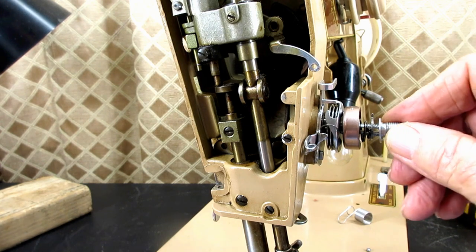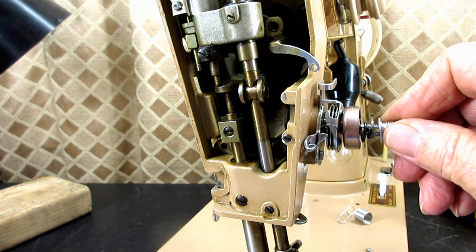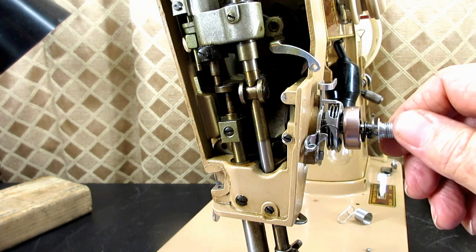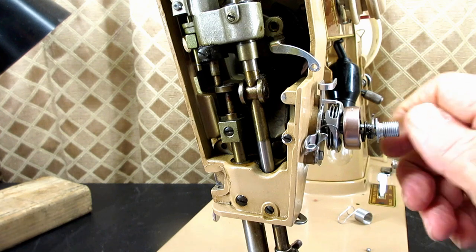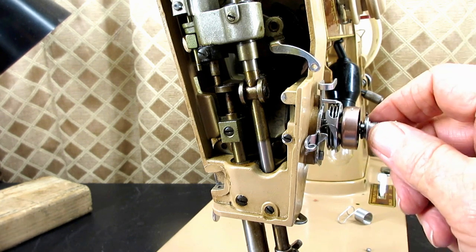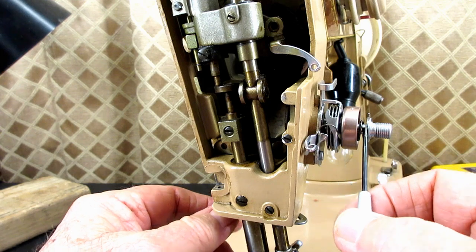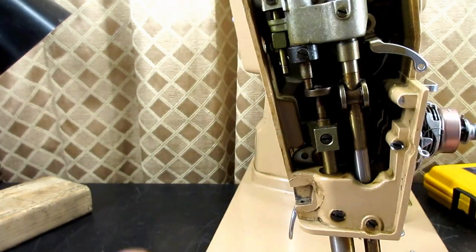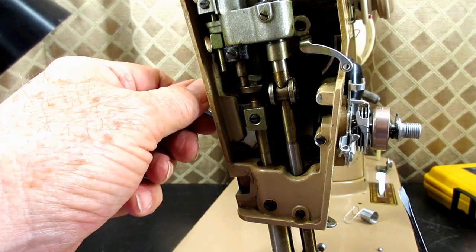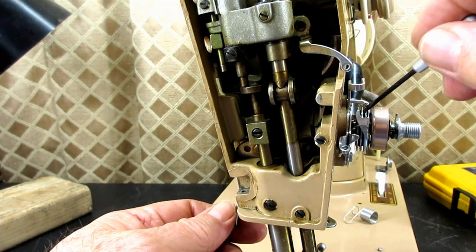Nobody makes these studs anymore that I know of, so be careful threading this — the stud is aluminum and you don't want it cross-threaded. If it doesn't want to go on and is kind of crooked, just kind of twist it backwards — left — or wiggle it until you get it seated flat. It should be fairly easy to put on; you'll feel some resistance. If you get it up or down you could strip the threads. I turn it backwards while pushing — turn it left to get it seated. Now see how it can twist all the way and put pressure. Then when I lift this, you'll see the indicator plate move forward against the spring. That takes tension off the disc; when you drop the presser bar, it puts tension on the disc and therefore the thread.